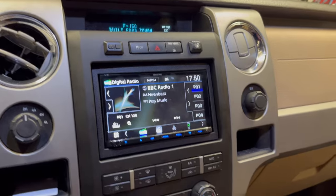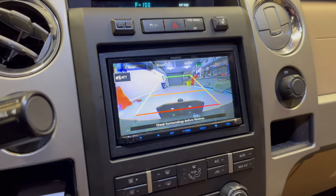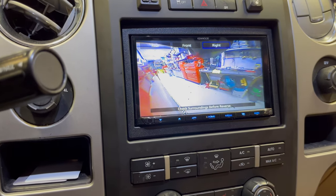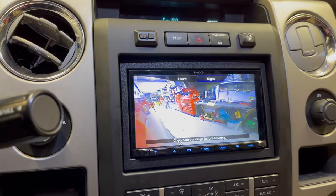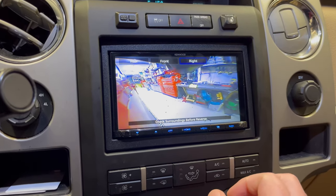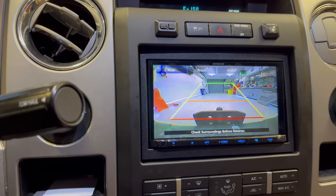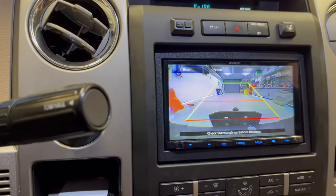We've also fitted a reverse camera for this customer — it's popping into reverse there, a bit difficult for me with it being left-hand drive. We've also fitted a side camera for them, because with this vehicle they actually tow quite a large caravan trailer type unit, which is one of the biggest I've seen. We can see the side camera image there, and if we go back to rear, we've then got the reverse camera. We've put a camera on the back of the truck, and also a camera on their trailer, so when the trailer's hooked up it will switch and display the camera from the back of the trailer rather than the one on the back of the truck — quite a neat solution.